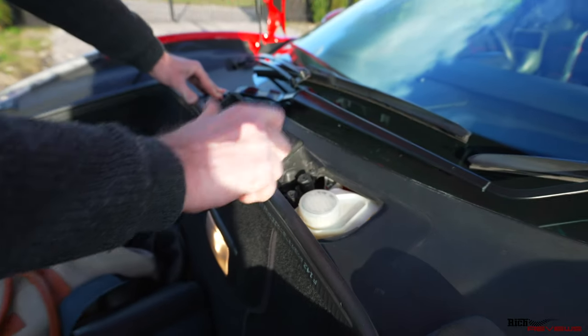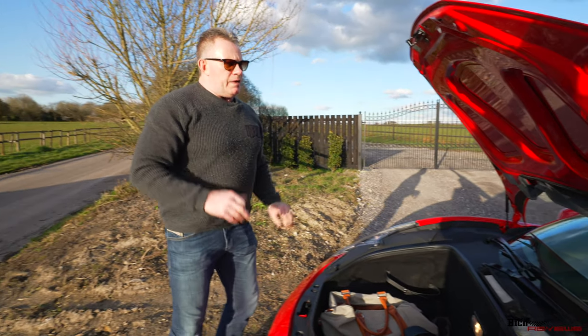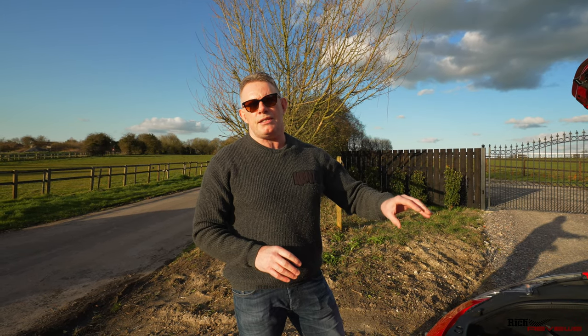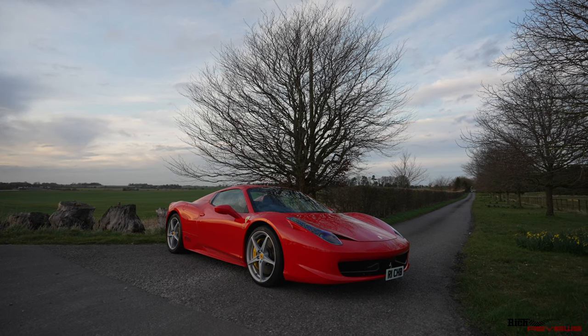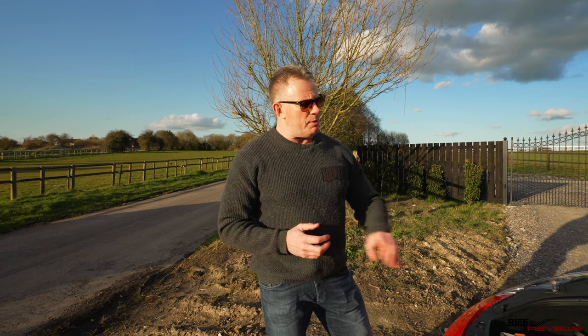The first item that's replaced for the recall is this cap, which is replaced with a newer version. The perception is that the brake leakage occurs when the brake fluid gets hot and expands. Because the existing brake master cylinder cap doesn't allow the pressure to escape, the brake fluid leaks out elsewhere, causing excess pressure within the system. At the end of the day, pressure is going to get out somehow, so it leaks. I'm not sure where it leaks. They haven't really detailed where the brake fluid actually leaks from. I don't know whether it leaks from the cap area or some other area.